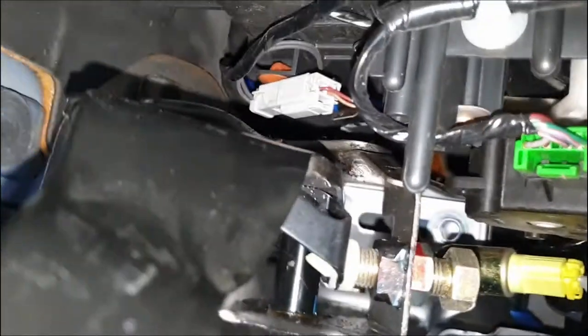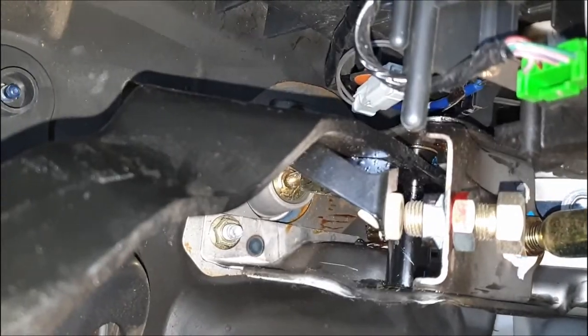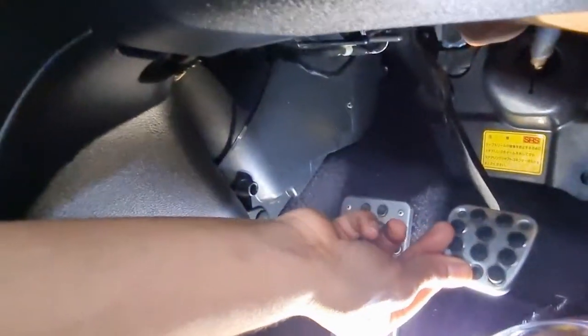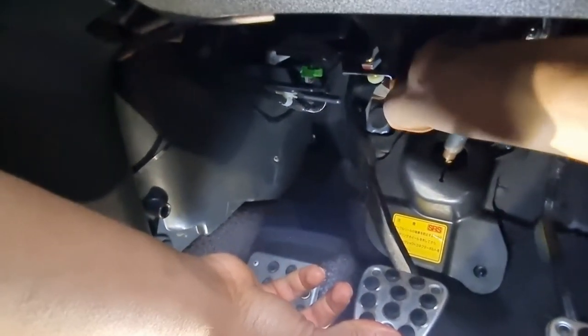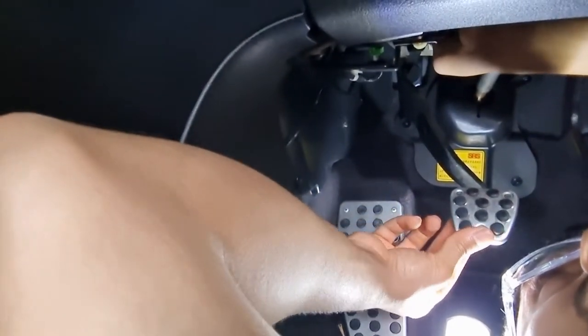The easiest way to do that is to take a little bit of slack off the pedal — go to the point where it's got a little bit of free play, so about there it's got free play. You can go ahead and just tighten that and take up the compensation. What I'm doing is getting this clevis pin and removing all the pressure off it — just finding the free play point. As soon as you find that point, you can easily adjust that push rod with your fingers. If you can't adjust it with your fingers, you haven't found that point yet.